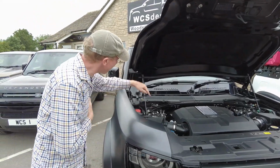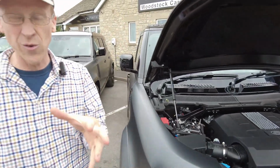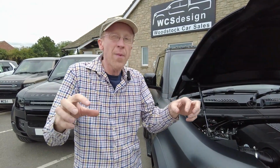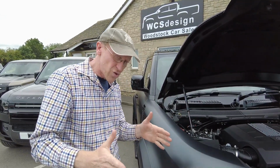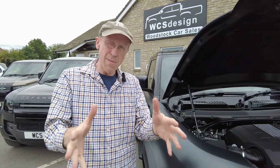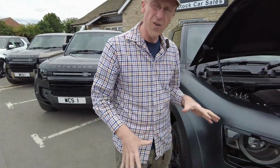So these cars have these little wires here. I believe these cars with the V8 engines have continually variable shock absorbers, continual variable damping. So they can assess the road conditions and firm up or relax the shock absorbers in all 4 corners and give you a more dynamic response. They've also got some really weird trickery, so that as you're cornering, it can adjust the torque going to various wheels to stabilize the car, torque vector by braking.